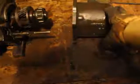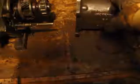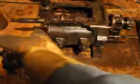First thing I had to do was remove the bolts that hold the overdrive housing to the standard transmission housing. To help you understand, this side here is a manual transmission. See, there are the shifters. From here to there, it's the overdrive, and this would be engaged by solenoids that are over there.